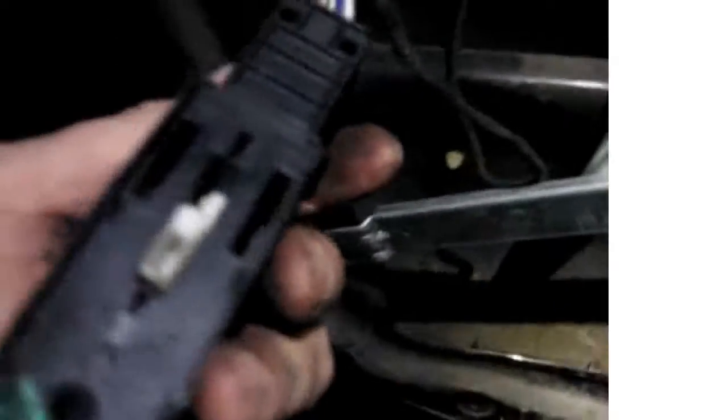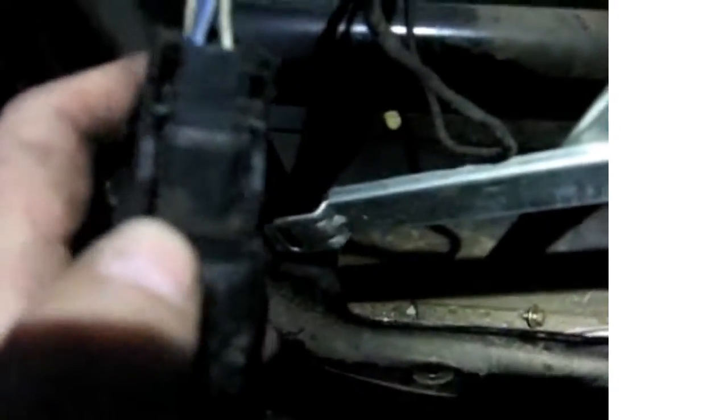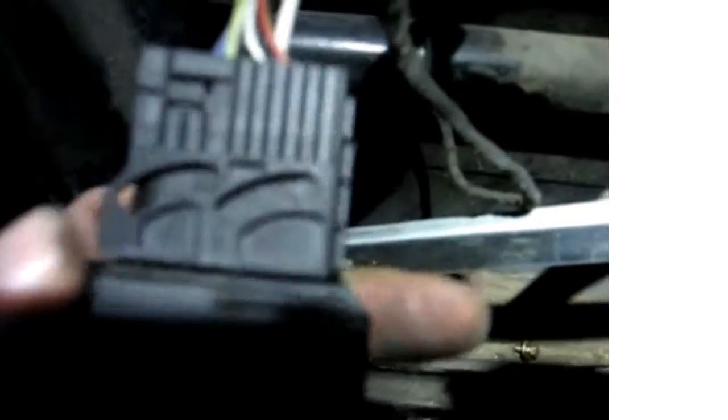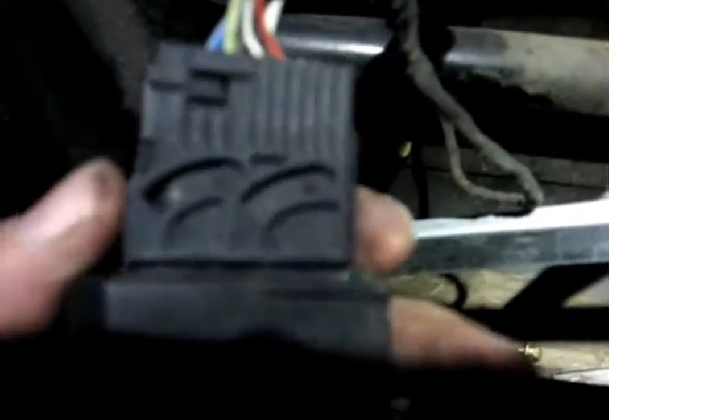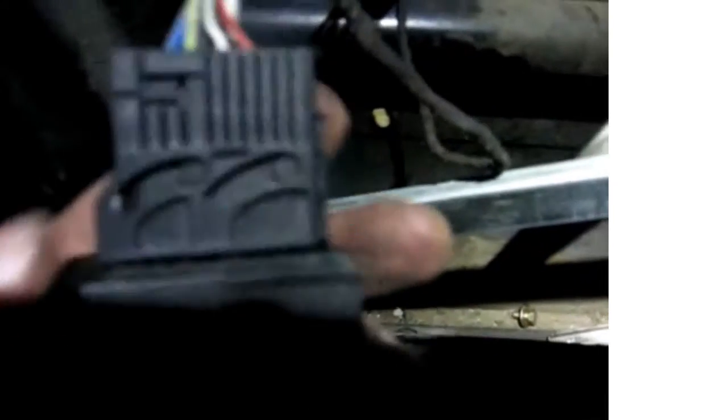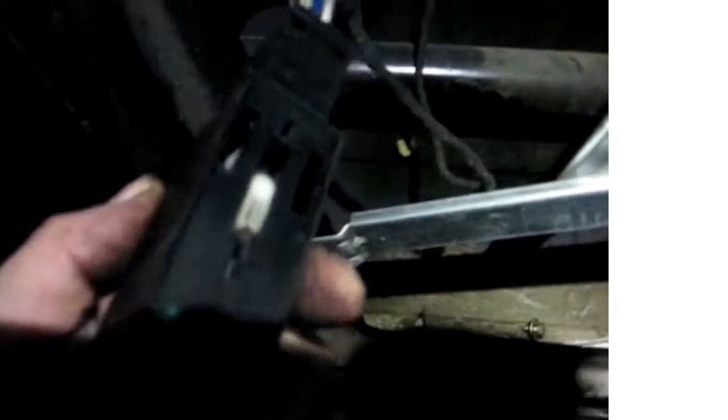And I did have to put the rod. I took off this bolt right here, and I slid the rod underneath here so I could twist it around a little bit more. But that was about it. The actuator, or this clamp itself, is kind of fussy. It's like a jacket around the actual plug. Kind of a, just so you can see it nice and close. Tough one to get off there. But I didn't want to break it and pry it, but it looks like it just pries open. So maybe those of you who know can advise the best way to get that. Anyway, hope this helps you guys deal with your door lock on a 92 BMW 325i Sedan, E36 type of model.